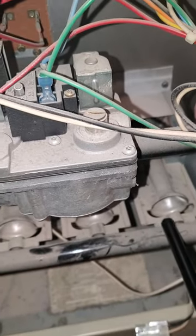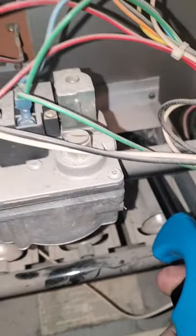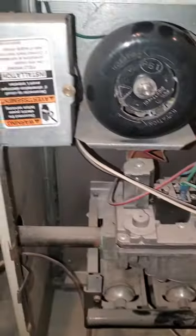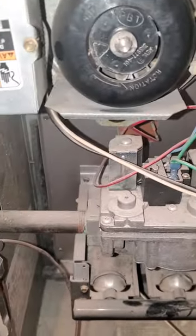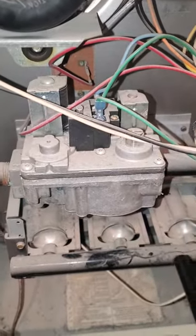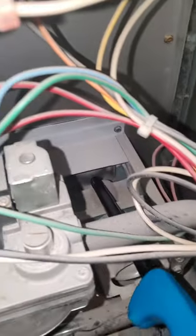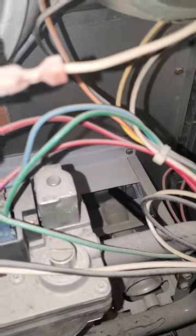The natural gas comes out through the tubes, and you're gonna want to hold the lighter back there. It'll start — you'll hear the fan kick on and see it, and then after about 20 seconds you'll hear a click and you should hear the gas flow. You want to light your lighter before the gas flows. Here comes the fan spinning — I like to get it ready now, because if you try to light the lighter after, you'll get a flashback and you don't really want that.